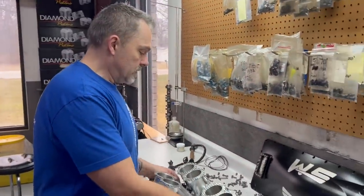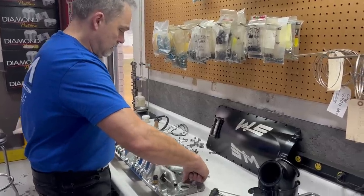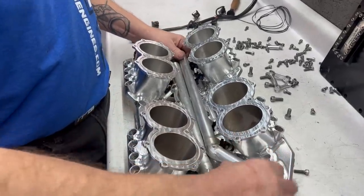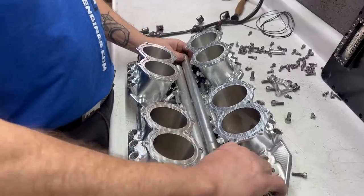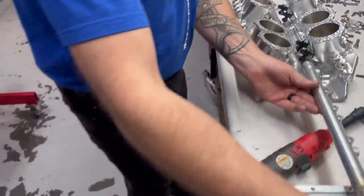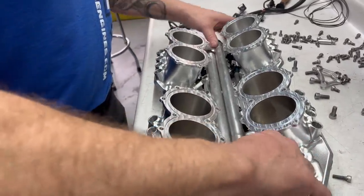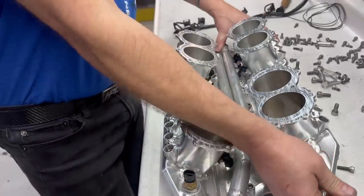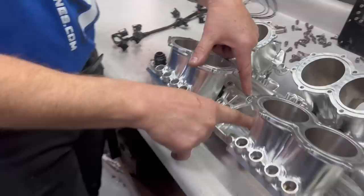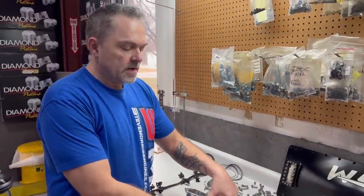And what we're doing here is the fuel rail needs to come in, and let's see, roll, there we go. Oh darn it, I had this all figured out, so hold on, there you go. So the rail needs to come in just like this, the injector's in, put it on the injector and just kind of roll it on like so. Problem is when these little brackets are on, it is nearly impossible to do that. In fact, it pretty much is impossible to do it, and it's pretty much impossible to take the brackets off and put the brackets back on.